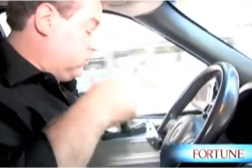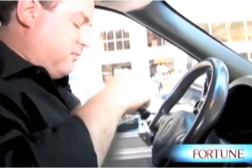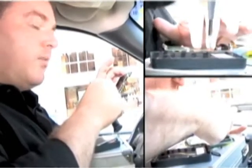I've taken the case off the iPod, off the Zoom, and I'm unscrewing the board, removing the LCD screen, and then I'm going to reattach it to a new LCD screen, put the hard drive on, and put it all back together.